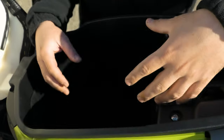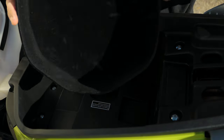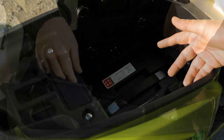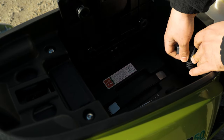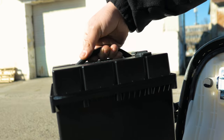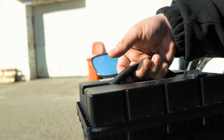Inside the seat area there's an on/off switch, and pulling back the black velvet material exposes the battery cover. Opening that up reveals the battery — you just unplug the main wire and pull it out. It's a 9-kilogram battery, and it has a small meter so you can press the button to check remaining charge. In the morning, just plug it back in and you're off to the races.